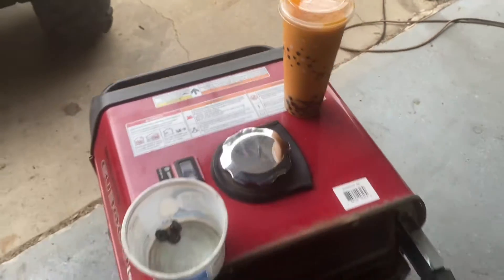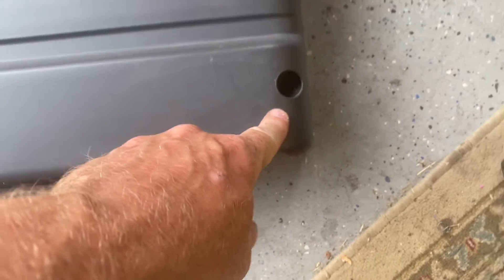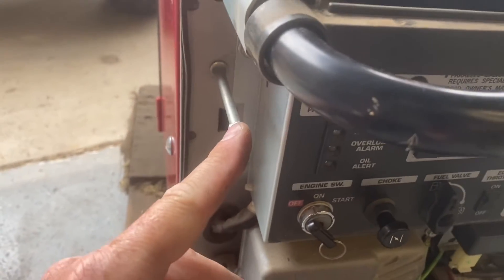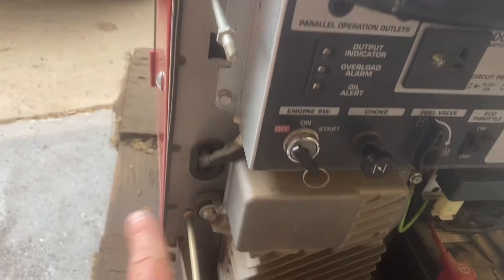One last thing — we're going to see if we can get this battery to hold a charge. I pulled this front cover off: four acorn nuts — one, two, three, four — and that cover comes off. Just don't lose the little inserts. If your acorn nuts don't come loose, chances are the standoff things are stuck to them — three out of four of mine were, so they just spun out. I reinstalled them and won't tighten the acorn nuts quite as tight.